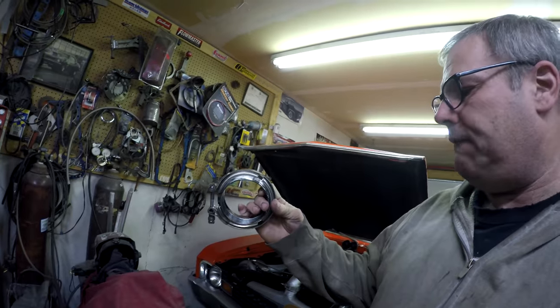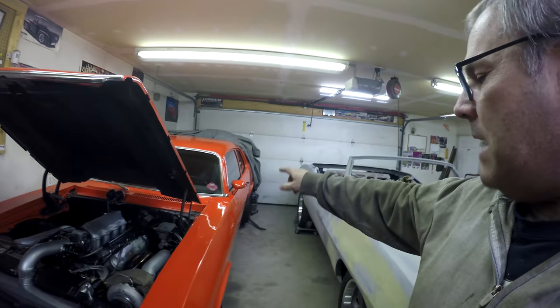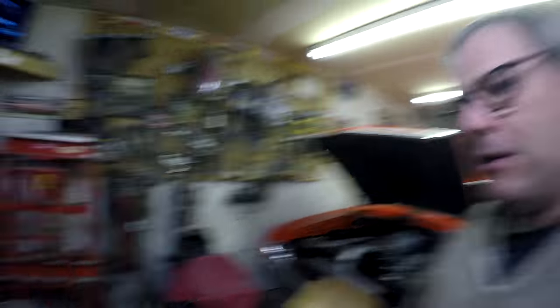I bought some V-band clamps — here they are. I actually have to order two more three-and-a-half-inch V-bands, stainless steel. My plan is to take the exhaust off where it goes down — there's one of those semi-truck-type band clamps and then a little further back another one, and the tubing actually slides over top of each other. It's just not the greatest way — they could slip off. I ended up welding some little tabs with bolts to the exhaust just in case so they wouldn't let go, but V-bands are a lot nicer. I'm going to order two more so I can put them right at the back of the mufflers so the tailpipes can come off easy.